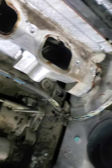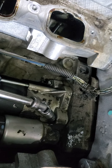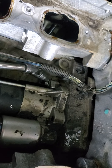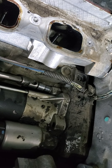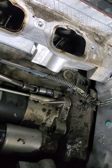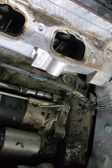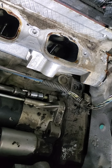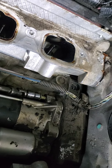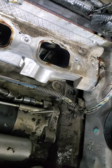We've got our nuts removed from there and from the trigger. The bolts that attach the starter to the vehicle are there and there — I've already taken the first one out. It's a little bit tedious to do with one hand since I don't have a tripod for my camera. These are 10mm bolts. Everything on this engine is metric, so don't try to use a three-eighths or anything like that on there.